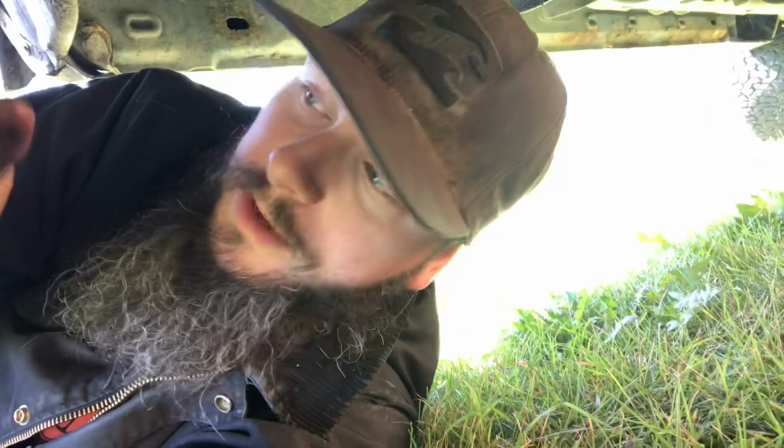And there you have it, a quick, simple crankshaft sensor replacement job for a 2003 Dodge Ram 1500 with a 4.7 liter. Extremely easy. You can do it in your driveway. You don't even need special tools. In most cases, you won't even have to lift your vehicle up unless you have a lower truck or anything like that. So with that being said, if you're doing the crank sensor, I highly recommend you do the cam sensor as well. It's equally as cheap, equally as easy to do. It's not even that far away from this sensor location. I'll go over that in another video here.